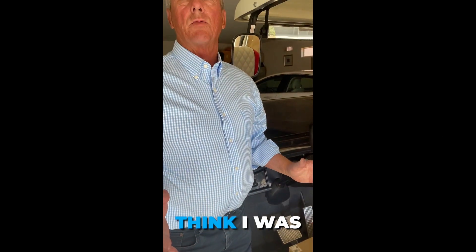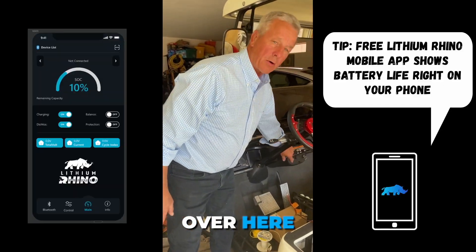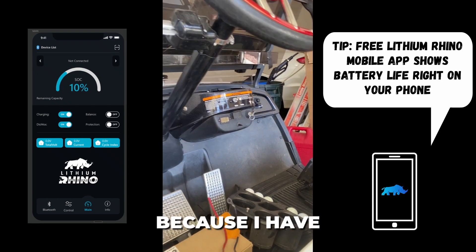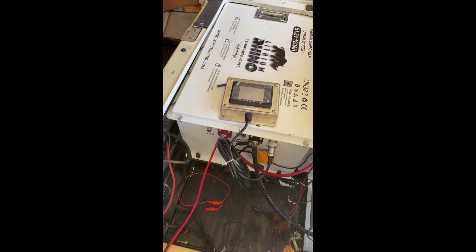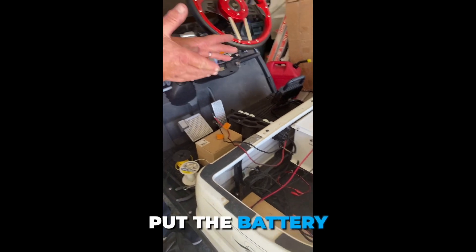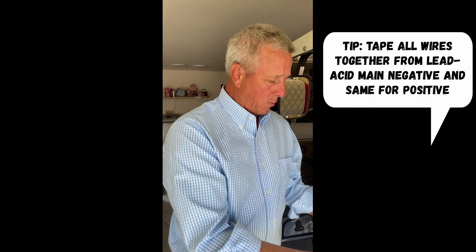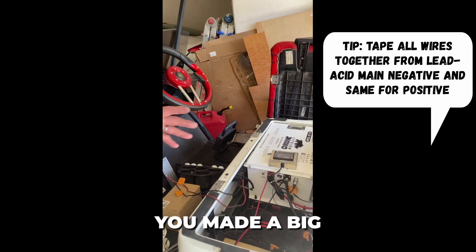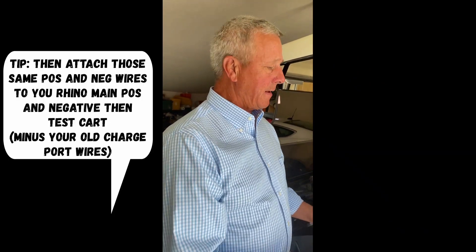There was a wire I didn't think I was going to use, but I had to have it. I have an actual meter over here now, so I thought I could eliminate those two wires. But when I put the battery in, the golf cart would move but the electrical would not work at all. I kept eliminating wires and finally said to myself: you made a big mistake — plug everything back in the way it was with the lead-acid batteries, then eliminate things one at a time.